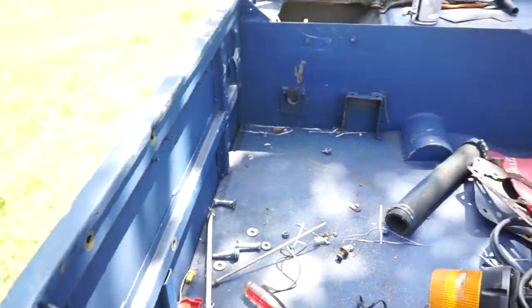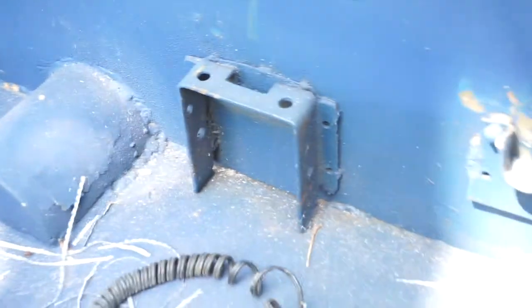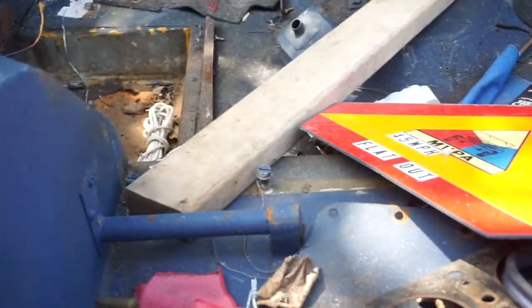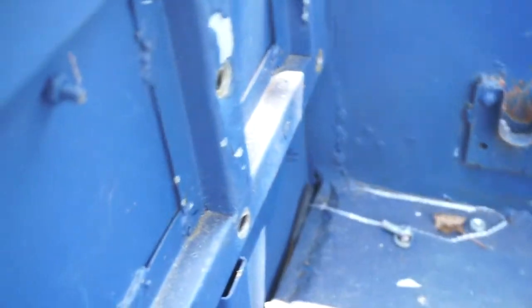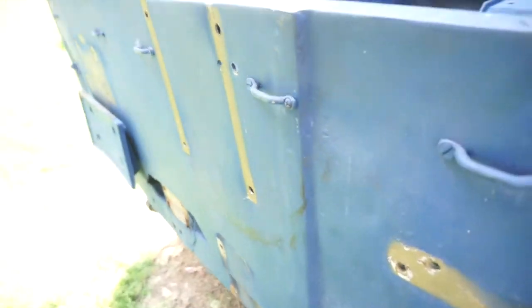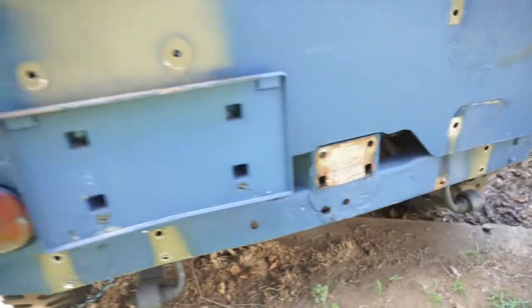You can see the stuff was pulled off the outside of the job boxes and put on the side of the plate steel. There's the welded shock tower coverings. And there's a close-up of the 1/8 inch sheet steel that's been put over top of the body, welded to the body on the rear floor. So I'm going to see about cutting that off, or if I'm just going to take it out with the floor because that does need to be replaced. The strongest metal is the front cowl, but there are sections on that that need some love too. Rear crossmember has seen better days — where the pintle hitch goes, it's just seen better days. I'll see about if I can rehab that — you'll see in future videos what I do with it.